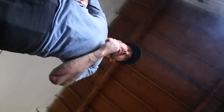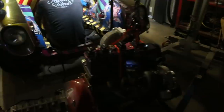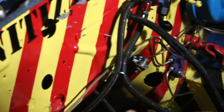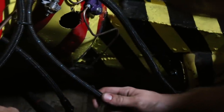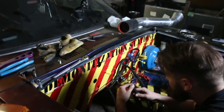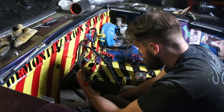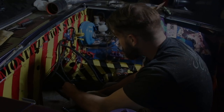We haven't gotten fuel pressure up enough to really know if any of the other ones are going to explode, but so far it doesn't look like they are. We said tomorrow, but we're doing it right now. We found out what the problem was and it wasn't my fuel lines. If you look into the firewall, somebody's been wiring in there and drilling all sorts of relays and shit into the firewall, and one of these fuel feed hoses was punctured. Sam, you asshole - a self-tapping screw was the issue here. Now I know what I need to do tomorrow - just replace this one line, then test it before putting everything back in.